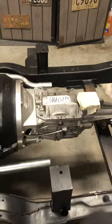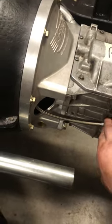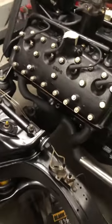I'm using a T5 five-speed transmission with a Speedway adapter. This is the clutch bleeder hose — I'll hook up the hydraulics later. Got the exhaust started — I got these headers and modified them to work, cut up some pieces. I'll bring the exhaust back once we get a bit further into it.